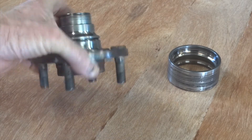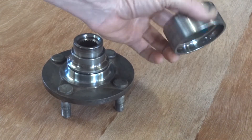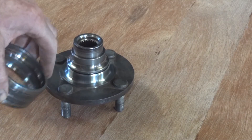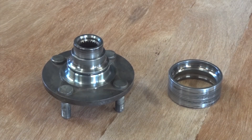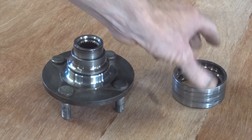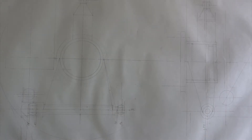We use the Nissan driveshaft as well, and accompanied with that is a double row angular contact ball race — that's the inner race there. It fits on nicely. A nice thing about using a double row bearing is you don't need to worry about bearing spacers; you can pop that whole assembly into the upright and it's all preloaded and ready to go.